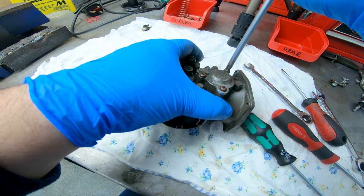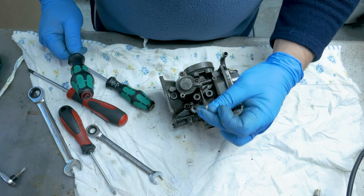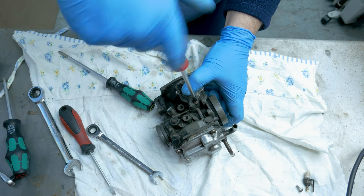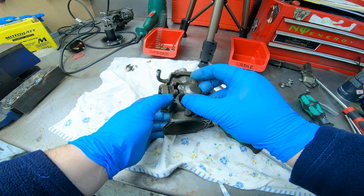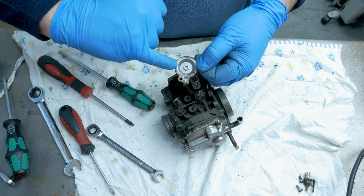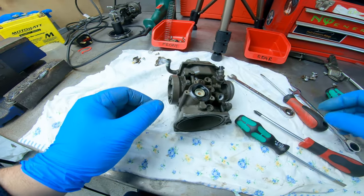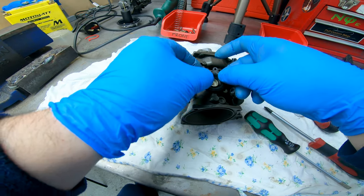I might try my anti-slip Phillips - oh yes, so lucky it's so butchered up. Normal JIS should be okay. Hold it down because it's got a spring behind it and the membrane. It's got a fairly strong spring behind it. That's the assembly and it's got a little hole there - so tiny you won't be able to see it. Then you've got the spring and this little membrane. If it's the same as the 1100, you have to unscrew the little jet behind it - but no, it's a little bit different.